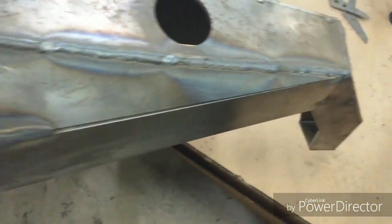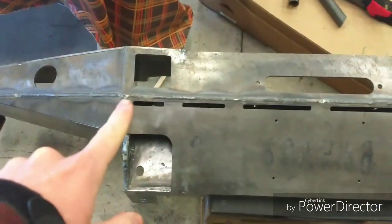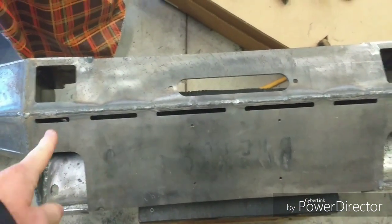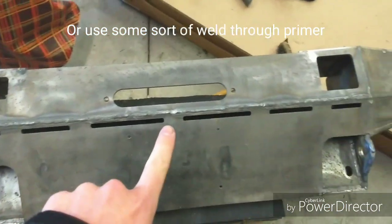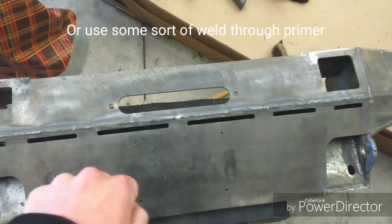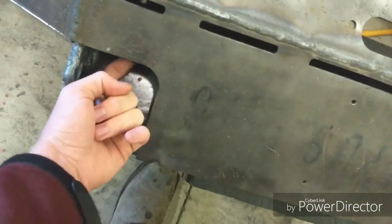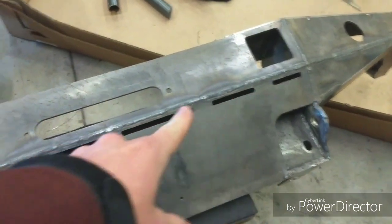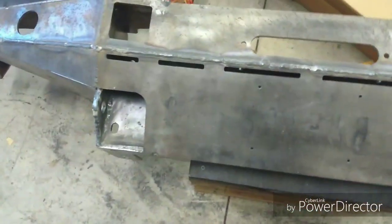I did that part right there, haven't done that yet, haven't done the bottom side of this plate. A side note: before you put this plate on, after you weld that perimeter, I would recommend painting this and putting some paint on the back side of the skid plate, because once you get it all welded up you can't really get in there. It'll burn the paint off around the back of that plate. Obviously I didn't do that — all bare metal in there still.